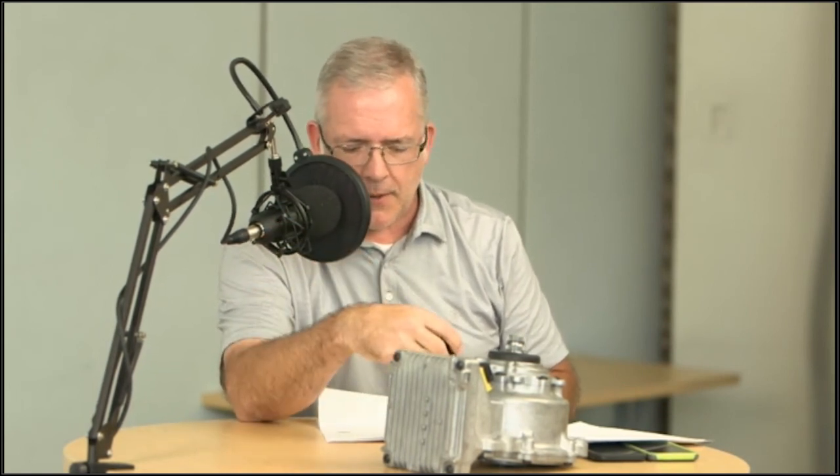Use that fuse pull as your diagnostic tool. It's simple, so let's use that. And then obviously, if you're sending your trucks out for the physical alignment, you want to make sure that you're pulling that fuse to bring that truck back under hydraulic steering only until you guys at the dealership can do your proper calibrations. Perfect. Thanks for that, guys.